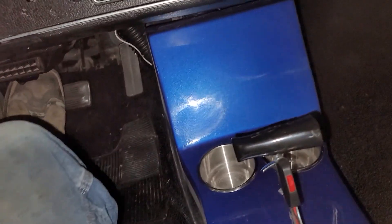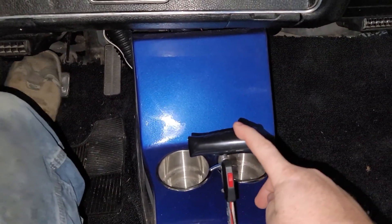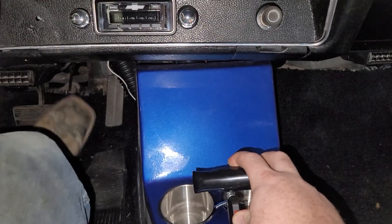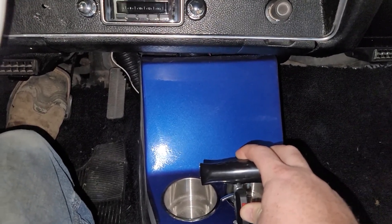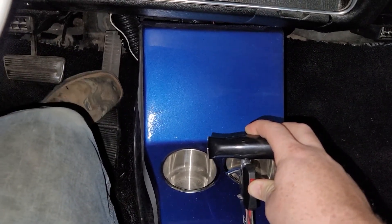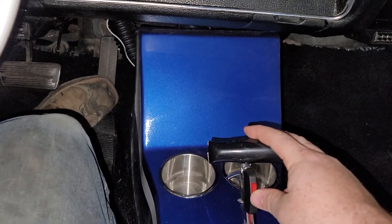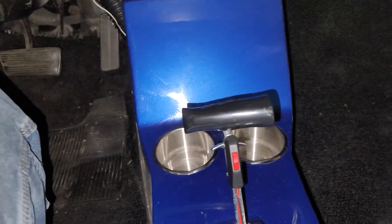Here's how you use this thing: press down the brake all the way, as hard as you can. Then press down the solenoid switch. Then let go of the brake. By doing that, you've pushed the brakes to the front and held the solenoid, which holds those front brakes — it closes the solenoid. When you let go of the brake pedal, it releases the rear brakes. Then you hit the gas. When you're done with your burnout, or the car gets squirrely and you need to move forward, you just let go of the switch. Very simple, very easy, nothing to it.